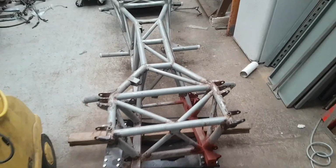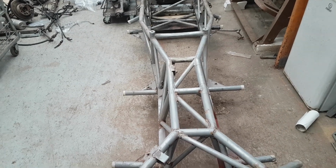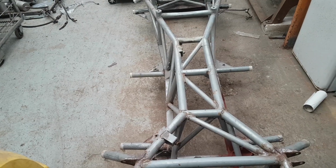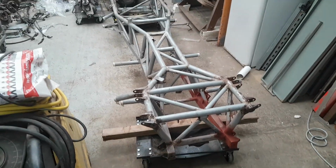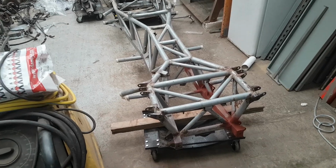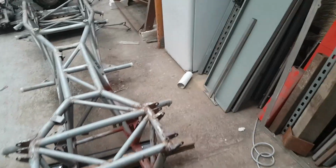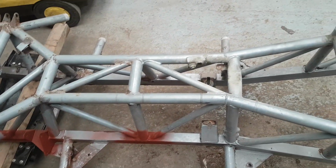We've decided we're making our own outrigger sections for this, which is a bit annoying, because really a lot of it didn't need it. We could have got away with partial replacement, but never mind. Hopefully they're going to get made next week, if not the week after, by which time I'm hoping to have the chassis blasted and in primer, so it can go in clean. And then when the new bits are on, we'll just blast those off to give everything a key